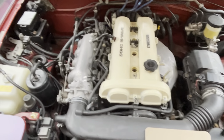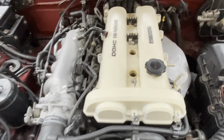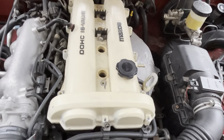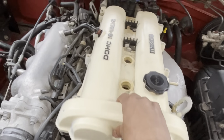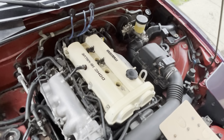Once you have every bolt out, slowly try to pry your way on it or just hit it softly with a rubber mallet. You don't want to pry under it with anything metal so you don't scratch the surface. If you have chipping paint, try your hardest not to get any of that in the motor. Just hit it on the side while giving it a little pull and it should come most of the way off. Note: for the 1.8 motor there's also a bolt on the back here and one right about here — take those out and the valve cover should pop right off.